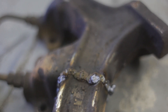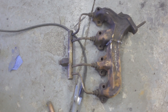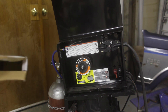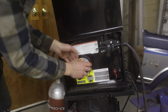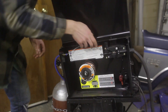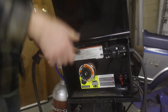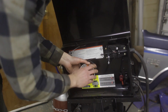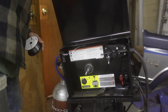I'm also probably gonna chop off all these - I don't know - thermactor tubes or whatever that system was called, and just weld those closed too while I'm at it. We're gonna try some flux core now. Those bolts you just saw were done with Harbor Freight Vulcan wire - 0.03 MIG wire using standard C25 mix gas. We'll try some flux core and see if the slag helps. Maybe we'll even try shielding gas with the flux core and see what that does.